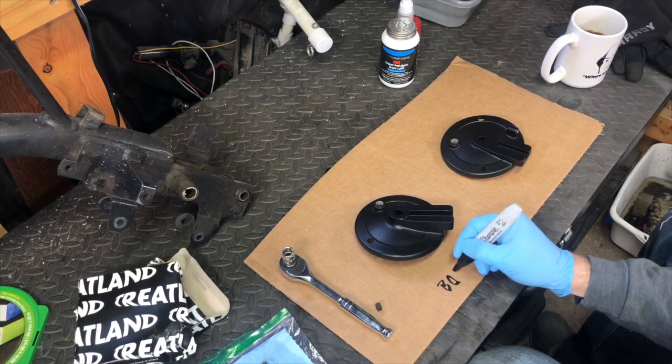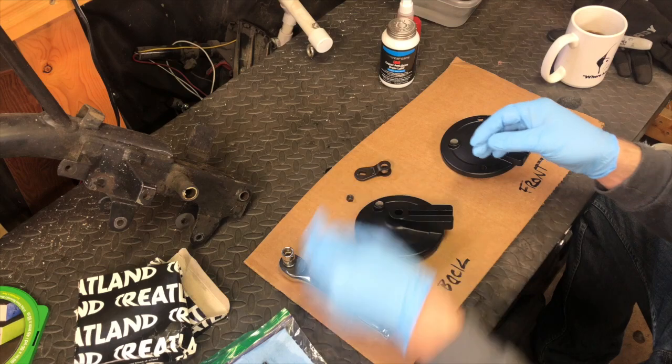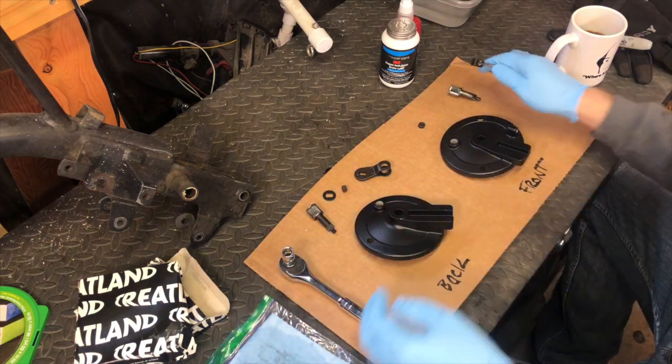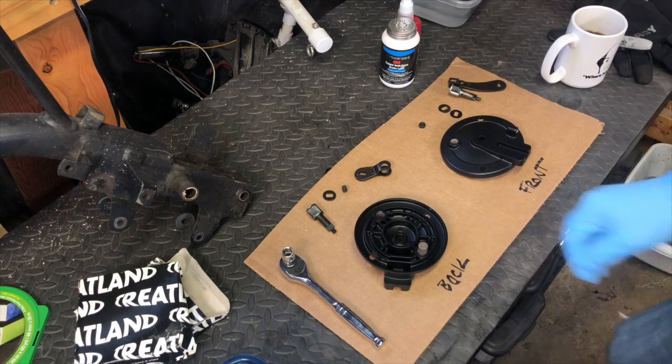And the last little thing this week is assembling the brakes. They're pretty simple. The levers get lubricated with copper anti-seize, and then I Loctite the nuts into place. The brakes get put together and levered over the pins so that they're ready to go into the wheel hubs. Thanks to Sir Gerbrick for the tip on how to do this. It went really smoothly.